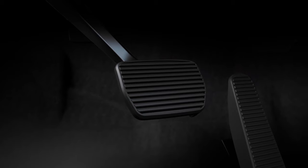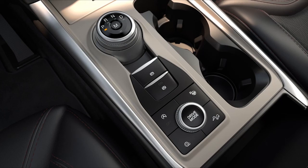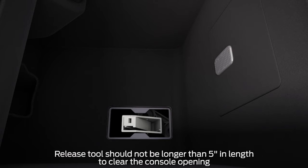Then apply the brake pedal and hold. Now, place the gear shift dial into the neutral position and insert the screwdriver or key into the manual park release lever slot. Pull the lever up toward the rear until the detent in the slot pops up. You'll know it's engaged when you hear a click.